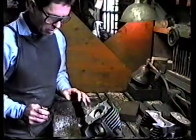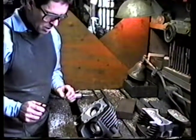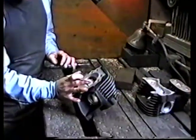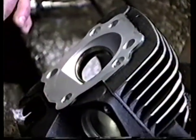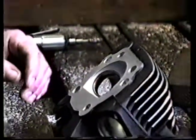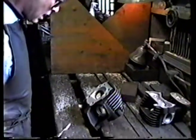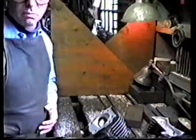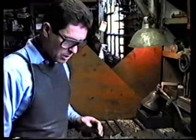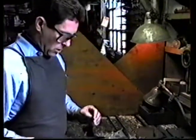We're also going to put a dual plug in this head, and when the job is all done, it will work perfectly. The combustion chamber will match the bore size exactly, and that's the object here. It's kind of noisy over here at the machine shop today. I'm going to cut a little metal for you just to show you how we start the job, and after I cut a little bit, then we'll come back and show you what they look like roughed out. That's actually what I'm doing today — we're going to rough these chambers out.